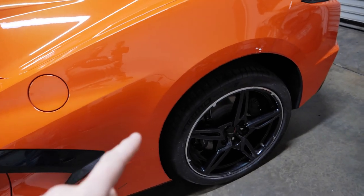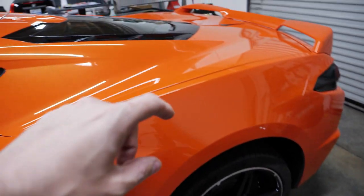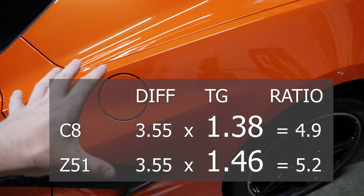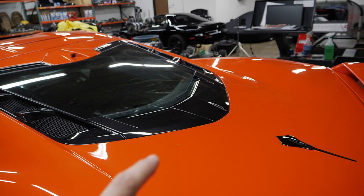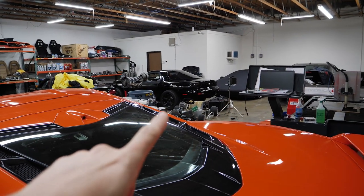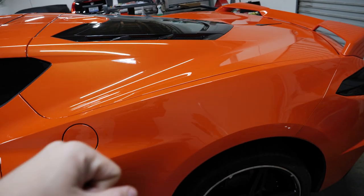The C8 also has what's called a transfer gear, and we'll dig into this ourselves. It might have a 3.44 rear end, but the C8 and the C8 Z51 come with two slightly different transfer gears. That transfer gear on the Z51 gives it a 5.2 gear ratio, which is oddly similar to the Ford 8.8 rear end in the three rotor — that's a 5.12. When you saw me driving the T56 Magnum on that, it was beautifully geared for that engine's power. This vehicle is meant for a rotary engine.